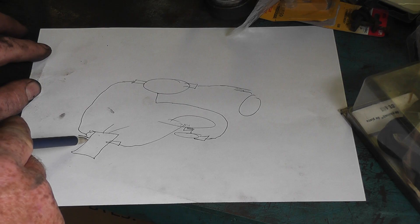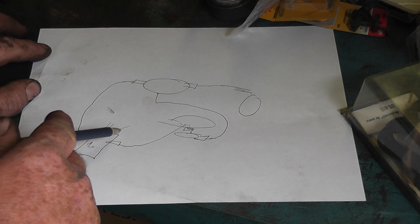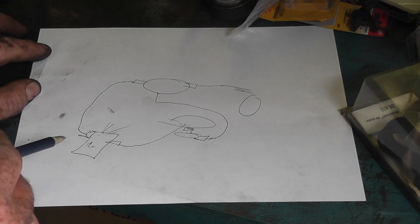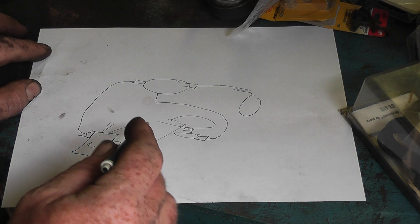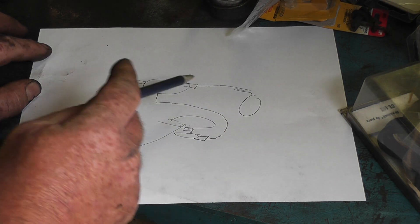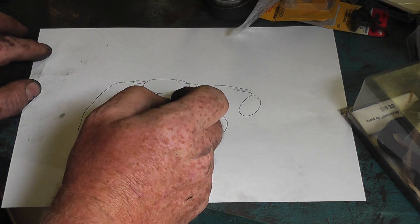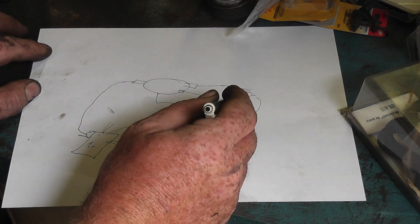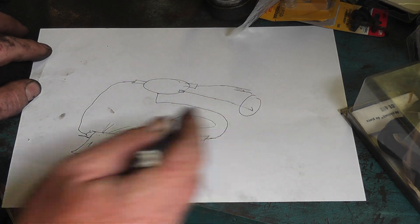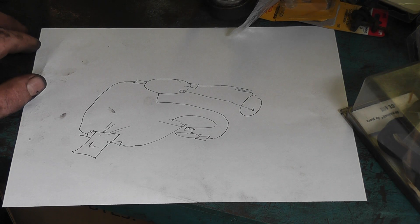You have a circuit to check on the solenoid — power and ground. I can't remember if it's duty-cycled or just on-off, so I have some wires back-probed into it. There is a third vacuum line up top that goes to the other side of the throttle plate — I'm not sure if that's a vent line. Since my Mitchell's down, I'm concentrating on ports P and D.